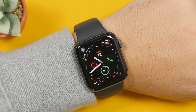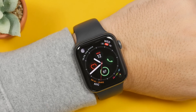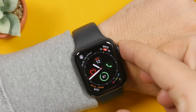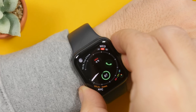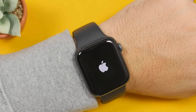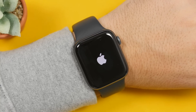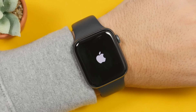If your Apple Watch is not working well and it's getting stuck somewhere, you can force restart it, just like you do on the iPhone. What you have to do is just tap and hold both the crown and the side button at the same time for about five or six seconds, and it will restart your Apple Watch. So if an app doesn't want to go to the home screen or isn't working well, just do this force restart.